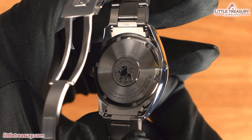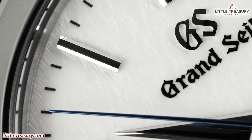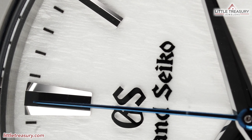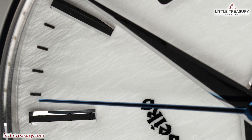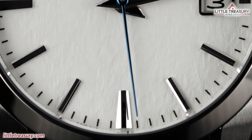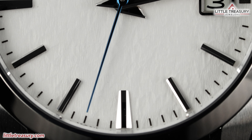The caseback is closed and has the Grand Seiko Lion in the center, and this is a major difference between this and the original, since the original has an open caseback and, of course, the spring drive. The movement is Grand Seiko's in-house 9F62 caliber, a quartz movement accurate to 10 seconds per year. Grand Seiko grows the quartz crystals and only picks the top performers to be used. They call this a twin pulse quartz because it ticks twice between each second, though your naked eye can only see one tick. This delivers high torque for the large hands, keeping them moving precisely. The batteries in these movements typically last around three years.